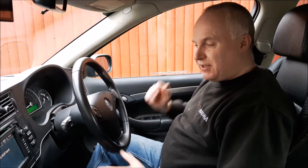The symptoms of this steering problem can be twofold: either you can have wobbly steering, or at certain angles the steering can feel stiff. Here in the UK, the MOT requirement is that the steering wheel rim shouldn't move more than a quarter of an inch.